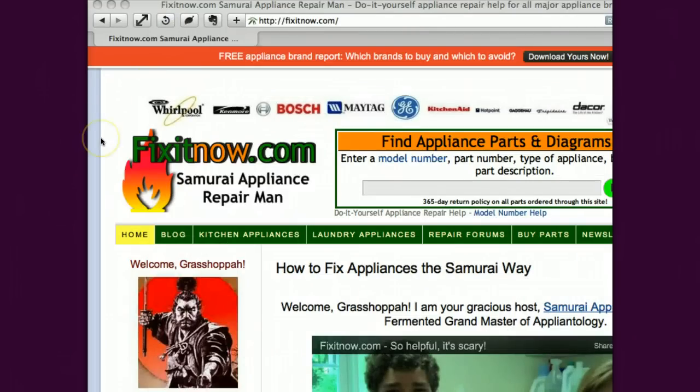So a couple ways to check this. One, it's a visual — you can just get access to the heating element itself and just look at it. That's easy enough to do. If you see this type of thing going on, you know you've found the problem. The other way to do it is by using your meter to measure from one of the terminals on the element to any ground point on the dryer. Your meter should read overload — OL if it's a digital meter, or infinite ohms if you're using an analog meter. If you read zero or some very low resistance, you've found the problem. You have a grounded heating element.